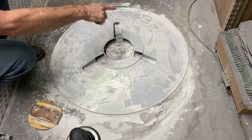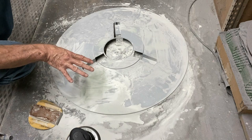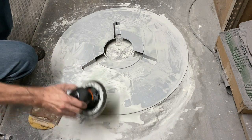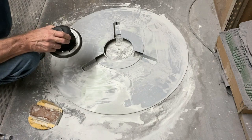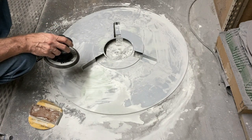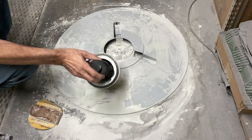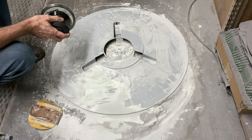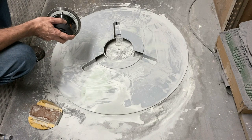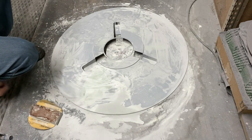I've got all the high and low spots filled in with our Evercoat and I worked down the initial build-up with my air-powered sander, just going around it using water. That helps cut down on the clogging of the sandpaper, and this doesn't spin super fast so it doesn't splatter it around too badly either. I've got that worked down to the point where it's all been leveled out and I've been finishing up doing some block sanding.